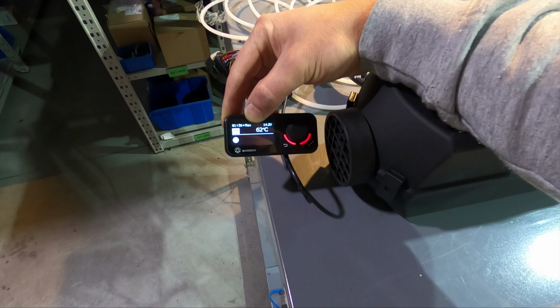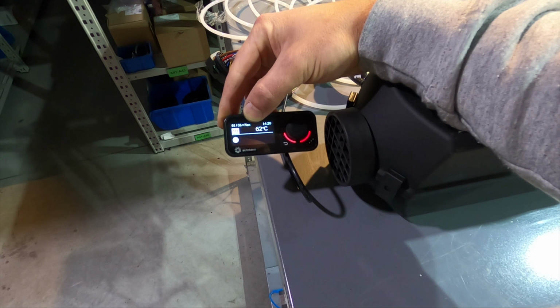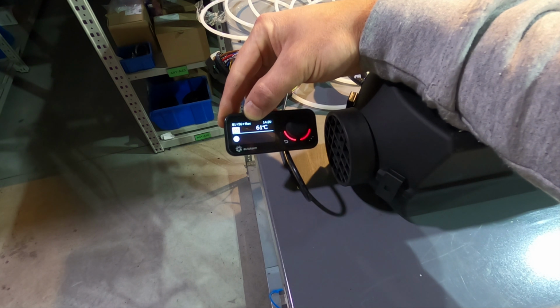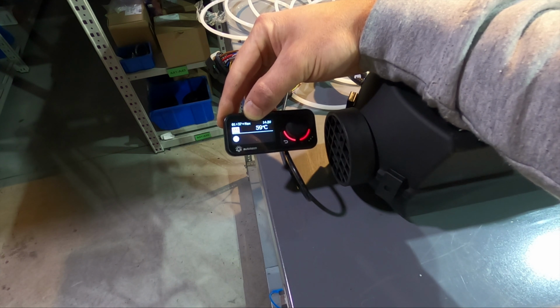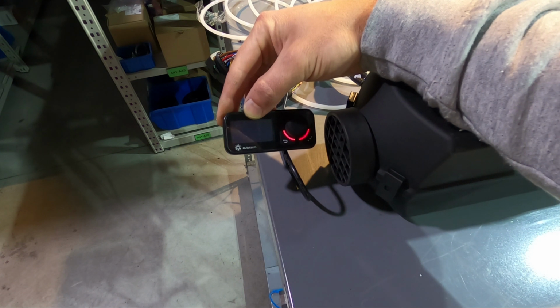And the other two, the heat and ventilation, I did not test, but I really think it's similar to thermostat mode. The only thing is it will not stop the fan. So thermostat mode works. Yeah, you can set the temperature and the heater will stop. So it will stop the combustion process at the exact same temperature, but without going into a lower power level. So from max it will just stop the burning, and then when the temperature is low again, it will again start the heating process.